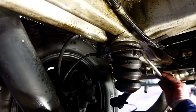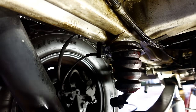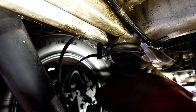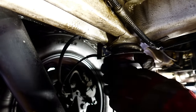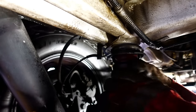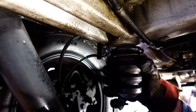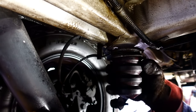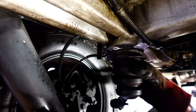That is going great guns. I need to go and get my gloves on. That is the next thing, so I can grip it and turn it. Okay, the gloves are on, and now we're going to just remove that bump stop. So guys, if you're doing this job, just make sure that the vehicle is well supported. Get some really heavy duty jacks, and by all means use axle stands if you've got some available, but just be super careful. But there's no need to get the wheels off the ground. We're just literally taking the body of the vehicle away from the chassis of the vehicle, the axle.